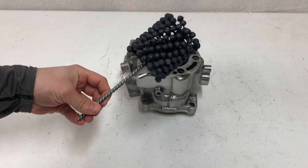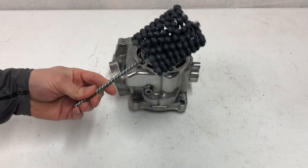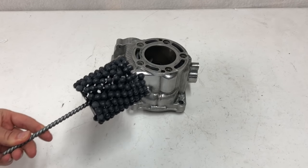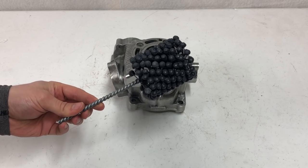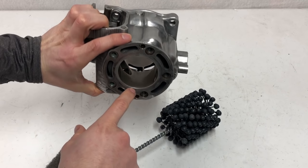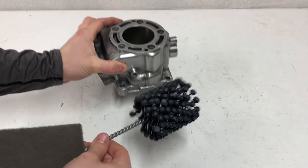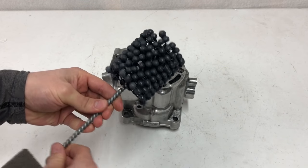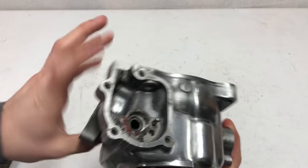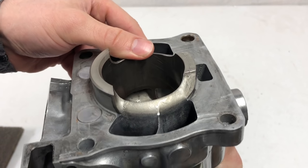I could make a 10-minute video alone on how to prep your cylinders, but I'm trying to keep it short and condensed. When it comes to cylinder prep on two-strokes there's a lot of misunderstanding or conflicting ideas from engine builders. A lot of people use a flex ball hone or a brush hone like what Wiseco sells. These are okay to use but you have to be careful of the balls catching in the two-stroke cylinder ports. I do use ball hones if the cylinder is pretty worn — meaning consistent up-and-down lines in the cylinder. But basically what I'll do on this cylinder is just use Scotch Brite because it's not that worn. You can actually still see the cross-hatching from the last time it was honed.